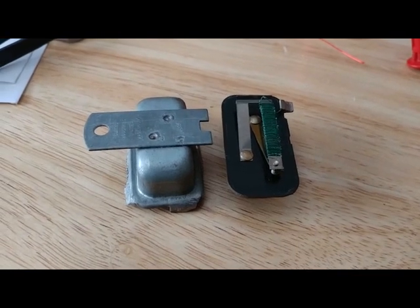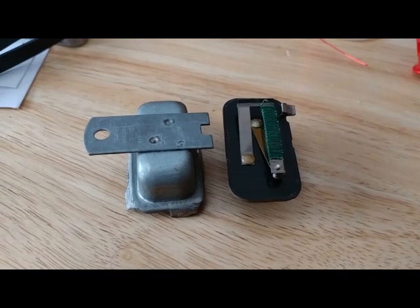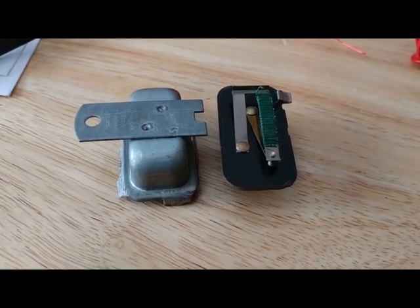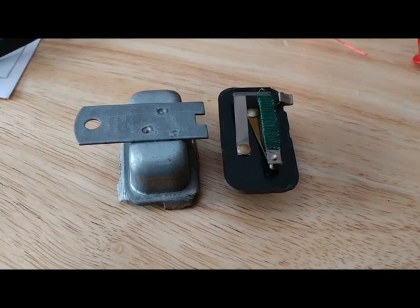Today's story is about a Smith's voltage regulator, which little British cars used to convert the battery voltage — which would be some voltage between 12, 14, sometimes 9 volts — into a regulated 10 volt supply for the fuel gauge.